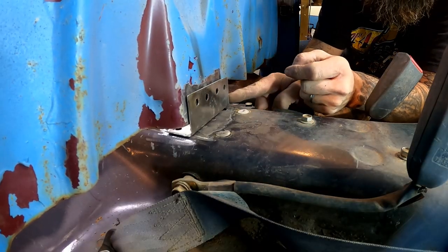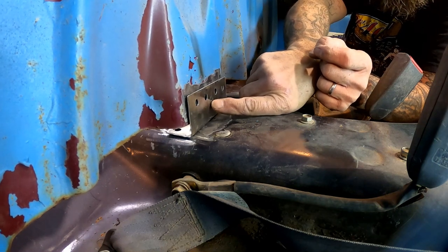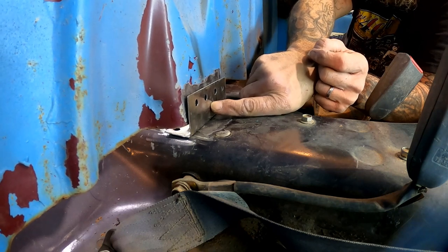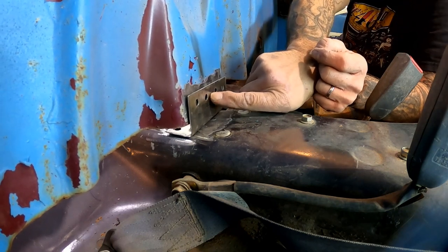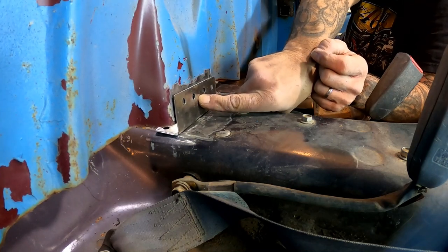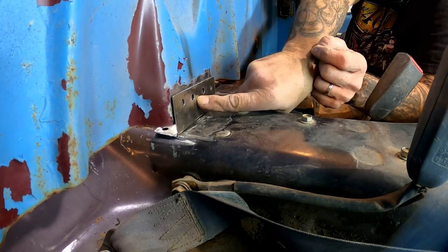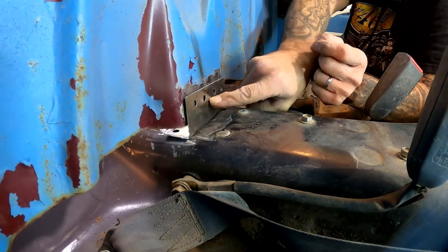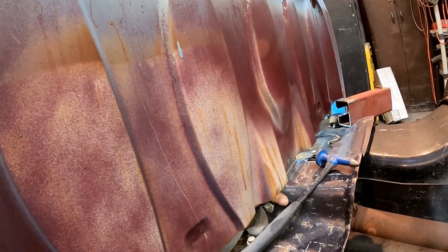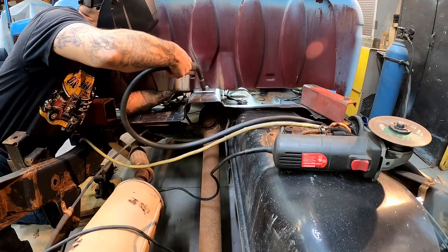This piece is going to slide right in there just like so. We'll attach it — I think what I'll do is push it out just a little bit. Every little bit counts when you want some room for speaker boxes or something like that, and we have the ability to get an extra inch and a half of room just by doing a little adjustment. I suppose you wouldn't want to push it too far back because you don't want it to interfere with the bed, but I think even putting it about right there would be okay. Let's see if we can get our first weld on here.